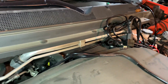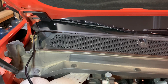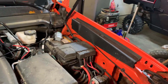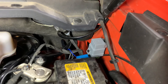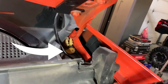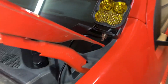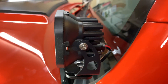Let's move on to the wiring. The longest part is just routing the wiring properly so it doesn't touch anything too hot, burn, or get pinched by the hood. The heavy-duty wiring harness that comes with the kit is plenty long for the job and it's good quality wire. The wiring is complete — we spliced our blue wire into the yellow wire on the relay for the off-road lights. We did not heat shrink the wiring yet, we're just test fitting. We ran the driver's side wire right under this rubber bushing. Diode Dynamics makes little zip-tie holes right in the bracket so you can hold the wiring harness to the bracket with the included zip-ties.